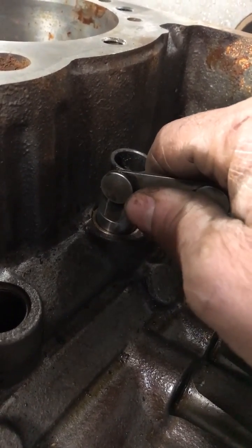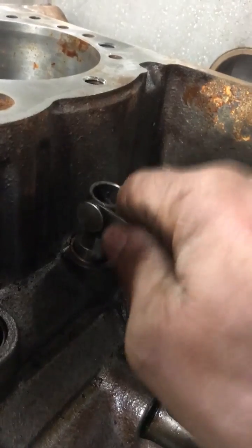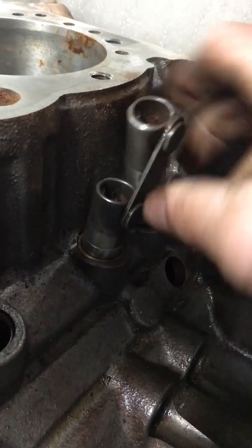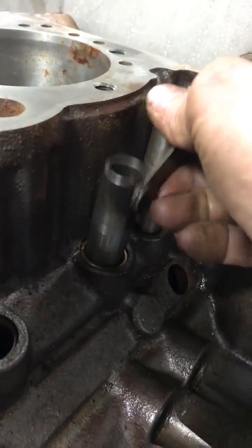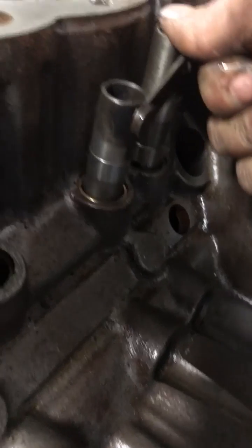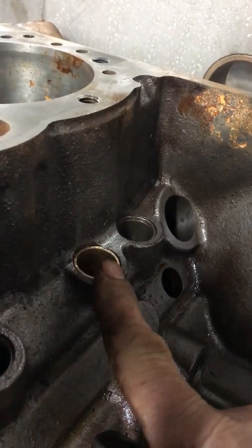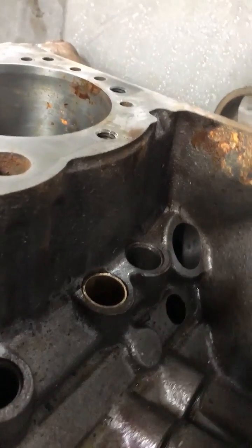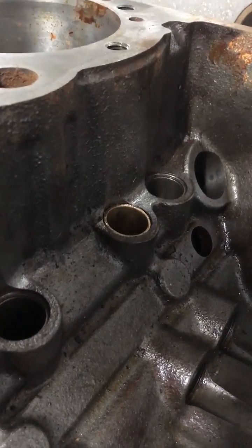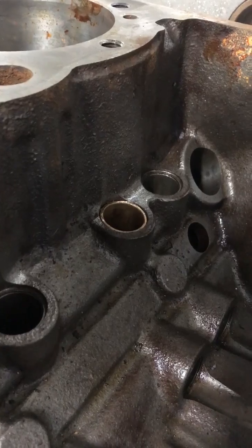It's got a lot of play in it — it's been put in too big. The lifter goes in real freely, but here's the thing: you try to put a set of lifters in and they will not go in, no matter how hard you try. The reason being is this lifter bore is put in five degrees crooked from the rest of the lifters. Anyhow, this is just a little video of why not to do the lifter bore methods that are out there on the internet of trying to do it with a hand drill, and what you should be doing in a proper machine.